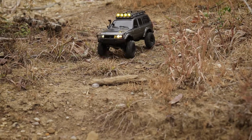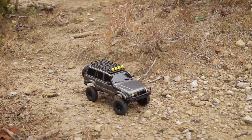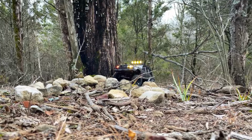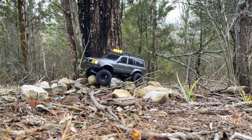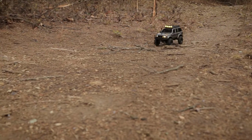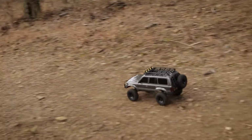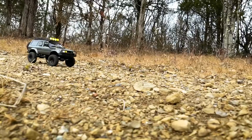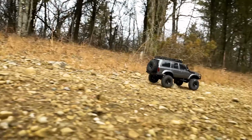As I mentioned, right from the transmitter you can adjust the drag brake intensity instantly by just flipping a couple of switches. This is great as when I'm slow crawling on some tough terrain, I want the drag brake to be on full. But when I'm in high gear cruising down some flat trails, I want the truck to coast when I lay off the throttle and not immediately slam the brakes. The suspension movement is so much smoother with these oil-filled shocks.